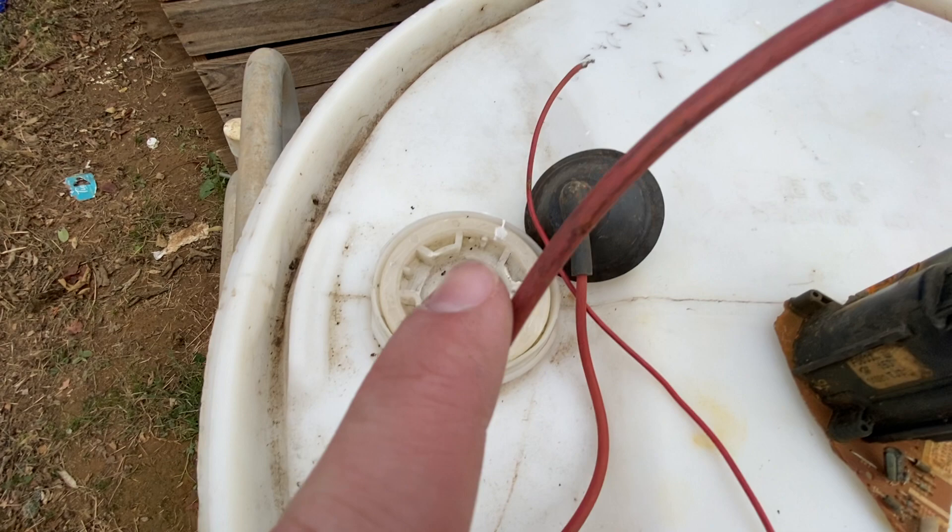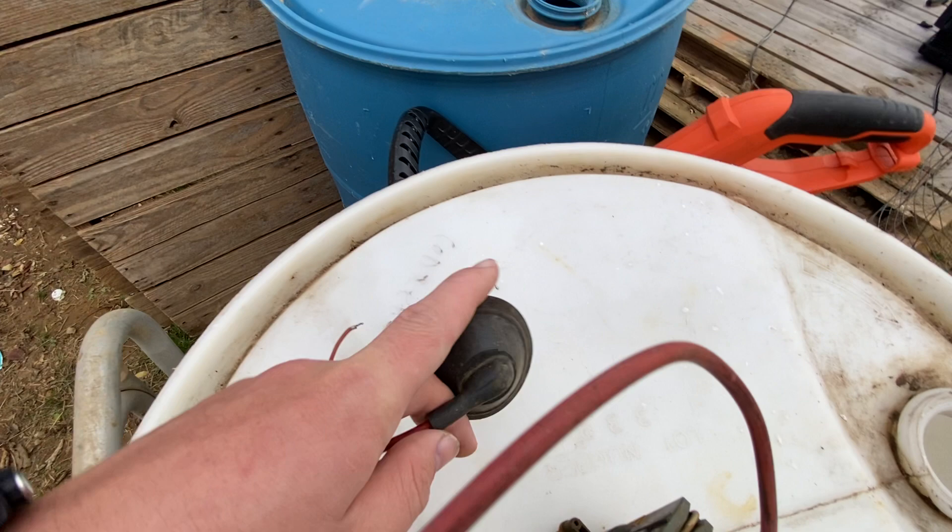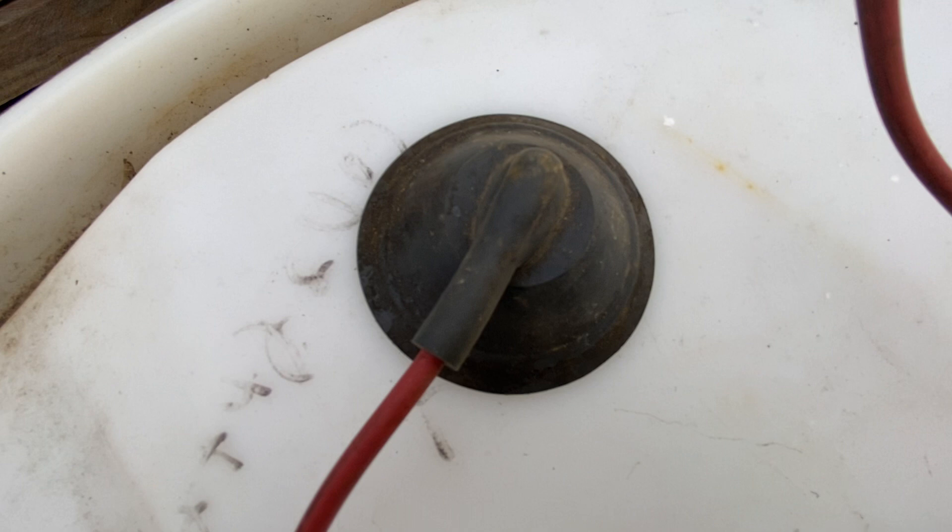The transformer delivers extremely high voltage along into this part to electrodes. You can't see them because that's a piece of glass from when I did take this off of the TV, but it leads to two electrodes, and the electrodes go inside the tube where an anode hole is.